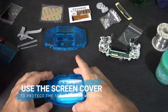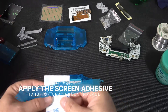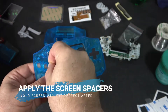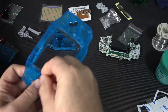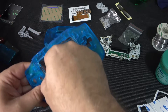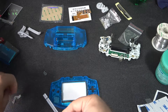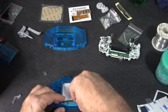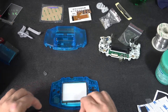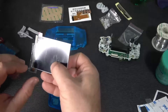Now I'm going to take the shell, put it down, and lay it so the screen clips in. When I lay the screen in, the protective film will protect it from dust and grime — though you will get fingerprints doing this. After applying the adhesive, these little positioning pieces go in — push them in firm, all the way over, so you have maximum adhesive area. This guarantees your screen goes in perfectly placed for the correct resolution and size. You cannot screw up putting the screen in.